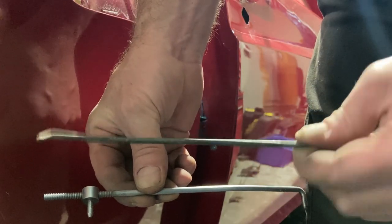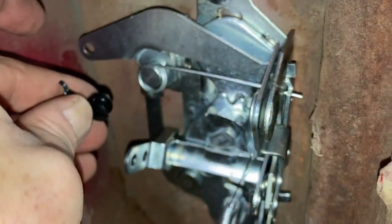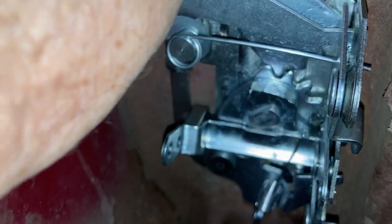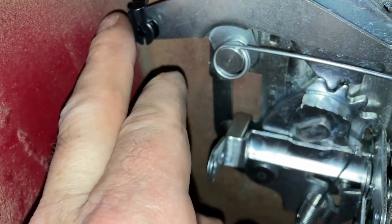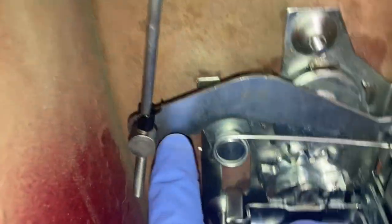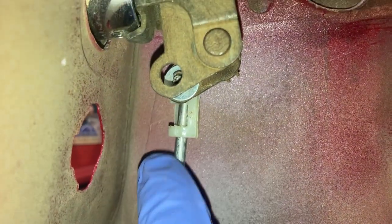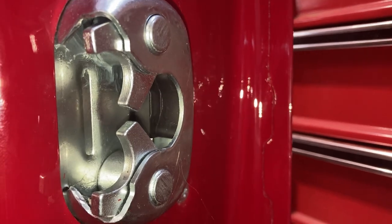As a comparison: this one has not been cleaned up yet, this one has been. Here's the latch on the inside — we're gonna show you how one of these clips go. You can see it right there and we're just gonna press it into the hole. Once it's fully installed, the rod will go in here and then this part will hook onto the rod and trap it. I'll show you that once the rod's finished drying. We get the clip right here — you can see how it sits on the rod. We put the pin through there, bring the clip, pop, it hooks the rod and we follow that up to the door release. When you push that button, you can see it's gonna pull the rod, which in turn is gonna pull the lever — and there you go, that's what releases your door.